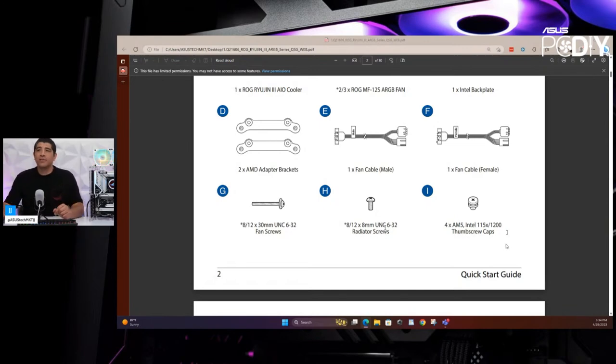So you do have the flexibility. You can use Armory Crate to do all your RGB and fan management, or you can also do it inside the UEFI BIOS. Also, a subtle little thing, but I like screws that have the washers integrated within them. It makes it a simpler, easier experience to make sure that you're distributing pressure across the corner when you're mounting the fans. So I think that's a nice subtle touch.